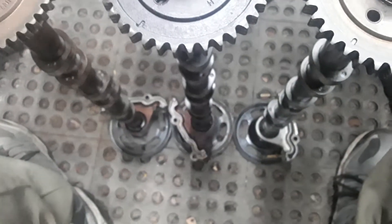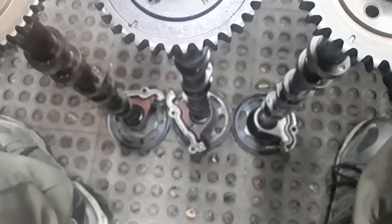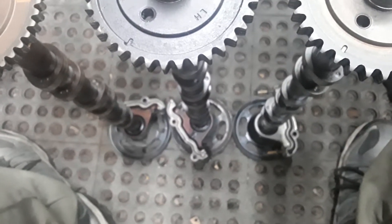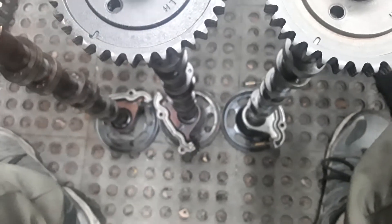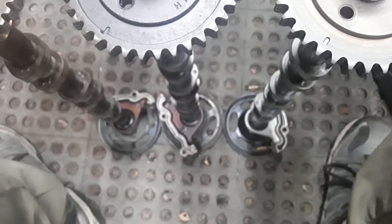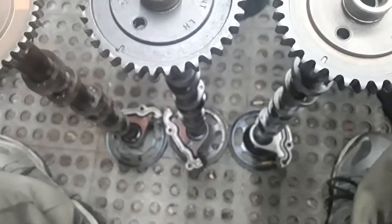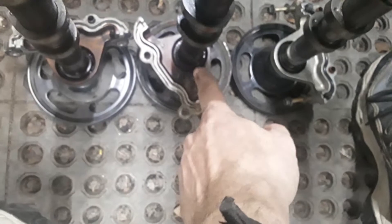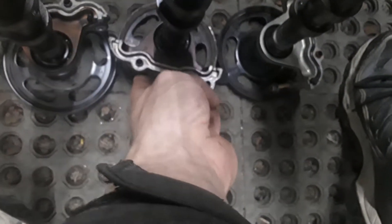These brackets don't really come off. The same can be said about the water pump pulleys on the end of the forward intake camshafts. They're pressed on there, and you're supposed to be able to pull them off, but everyone I've met who's pulled them apart has ended up bending the pulley. Then it doesn't go on well, and because you bent the pulley, the belt doesn't go around it properly, so you end up eating belts and losing your water pump. You have to remove that pulley somehow to service the seal, which bolts onto the end of the head.